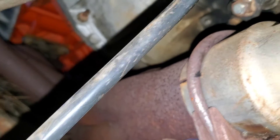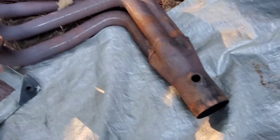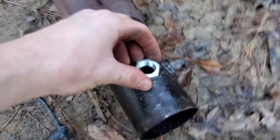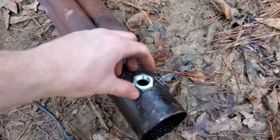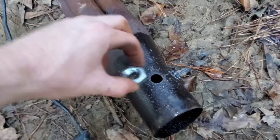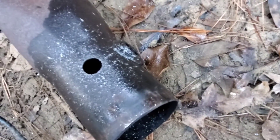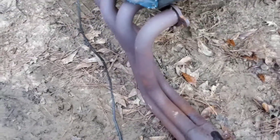As you can see, there's plenty of room right there up top, so I'm gonna put the O2 bung right there up top somewhere. All right, took a little persuasion but I got her off. Hole drilled — pretty much perfect size. Get that cleaned up, weld this on there, and then find something to plug that off with and stick it back on there.